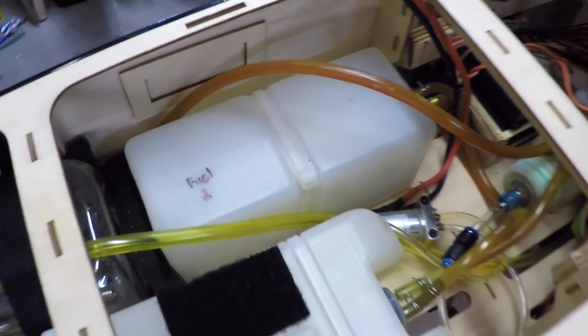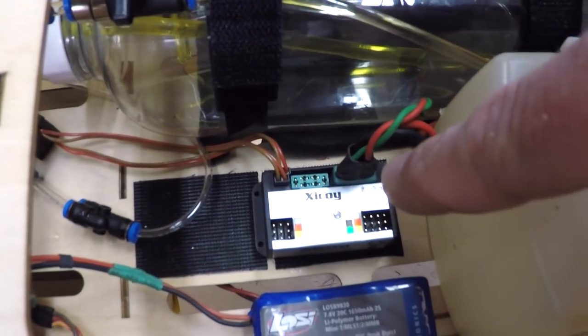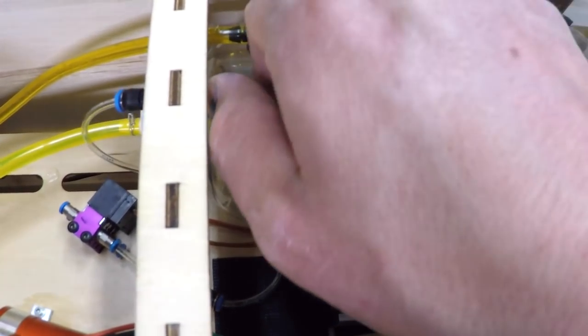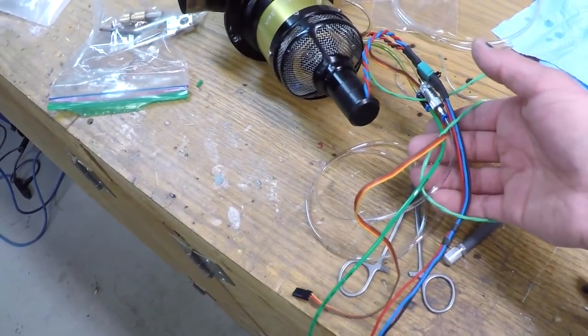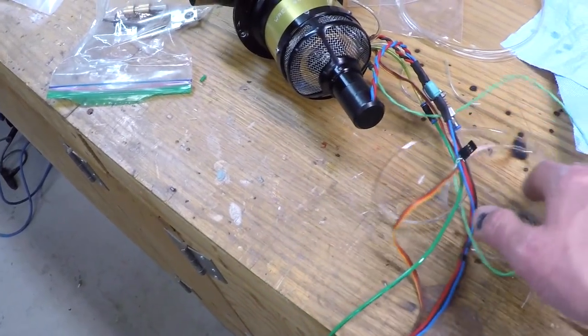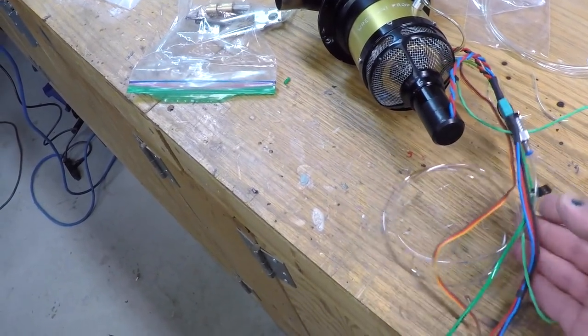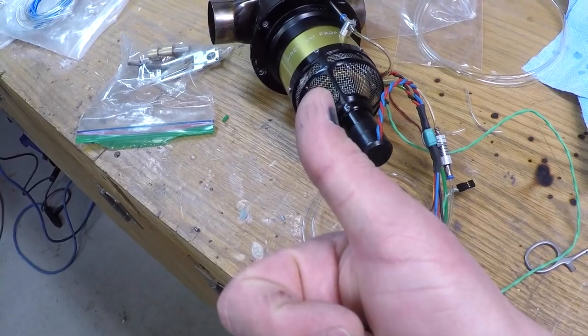So anyways, guys, everything's plumbed from the UAT: the fuel pump, the ECU's there, the solenoids and everything are plugged in. Here's the turbine on and off, or fuel on and off valve. So essentially with that all done, we do still need to put tie wire, or safety wire, on the two nipple fittings there. And now what we can do is basically feed the turboprop into the airframe. And all these things are long enough to plug into their associated areas. The fuel lines we'll have to trim, but we're good to go with mounting the turboprop.